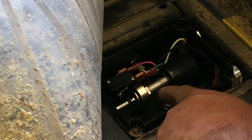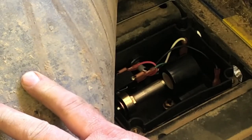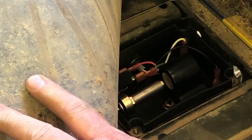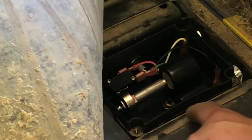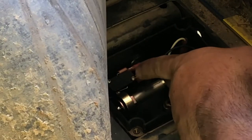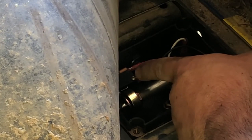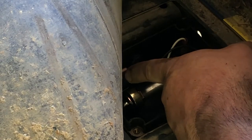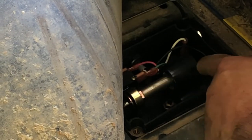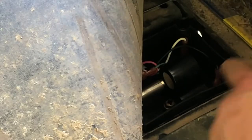So when you mash the throttle pedal you can see it going in. This is your throttle - they call it the inductive throttle response or something like that. So the more this shaft - your throttle shaft - goes in, you can see this little micro switch click as soon as you mash it down. This engages the power, and this reads how much the shaft is in. The more you push it the deeper it goes, all the way in, and that's full throttle. Fairly straightforward design.